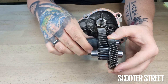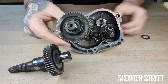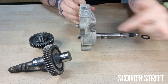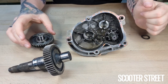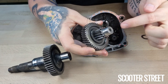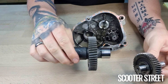The smaller gear on the idler is the second half of the secondary set — you can see these mesh together. The larger gear on the idler is the second half of the primary gear, and the first half of the primary gear is this gear here, which is part of the input shaft. So the clutch engages and spins that gear, which spins the large gear on the idler assembly. The small gear — one half of the secondary gear — is pressed into this, and they both spin at the same speed. That gear then spins the final drive.